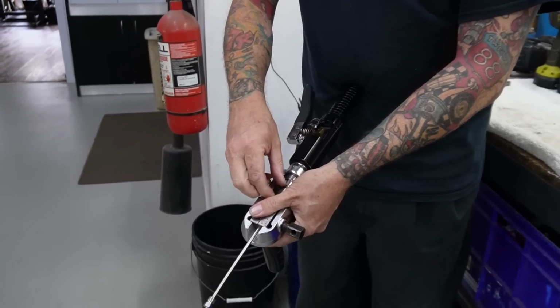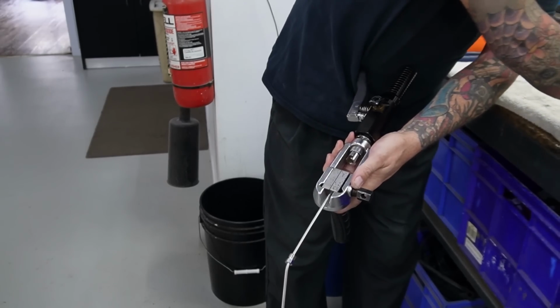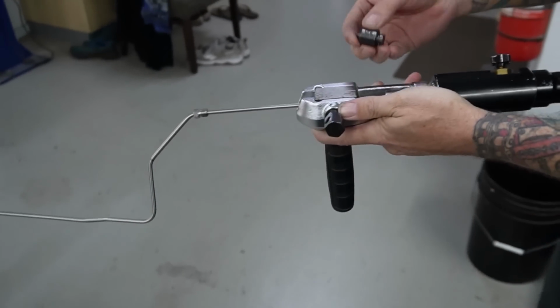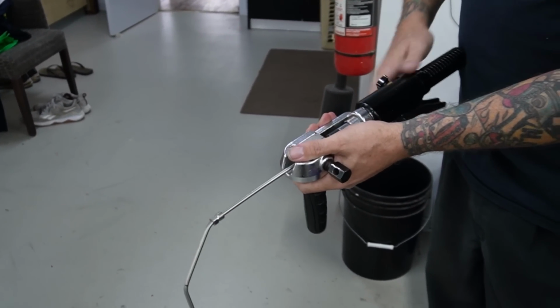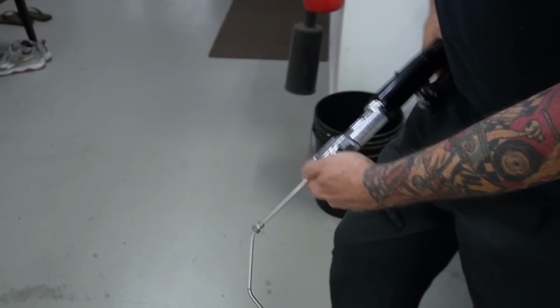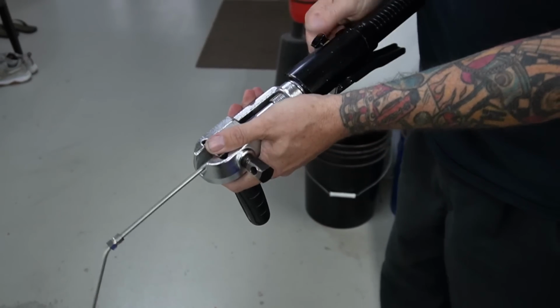It's a nice looking bit of equipment, that one. So he does the first flare. I'm not sure if you can see it with the video, but it does a pretty tight little bubble flare. And then you put the second one in. As he said to me the other day, with Ford, sometimes that's all it needs. A lot of the Fords only have the single flare. A lot of late model cars. Not that we do too many late model cars these days.